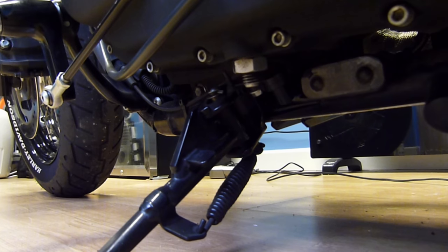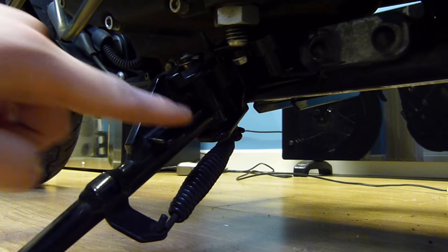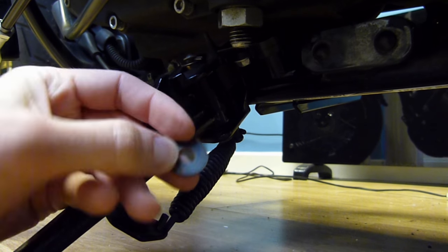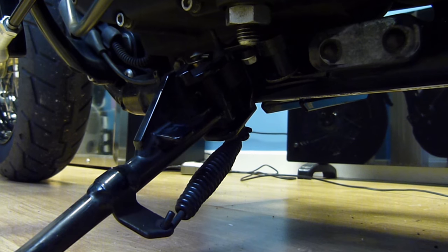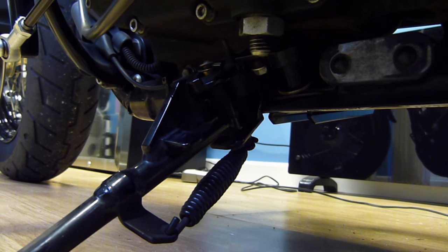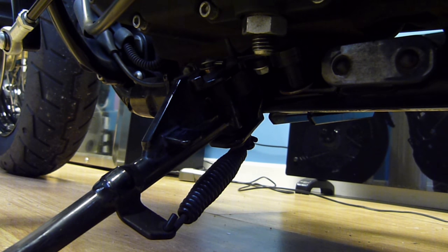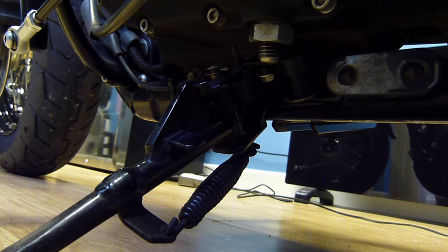Back in the garage and under the bike — you can see here the issue. Here is the plate I was talking about, and this piece here is the sensor that needs to detect it. The solution is really quite simple. All I have here is a small metal washer — you can use a coin or a rare earth magnet, whatever you fancy — and simply putting it on here, it attaches through the magnetism of the switch and will permanently override the sensor. I've ridden with this attached for about 2,000 miles through all kinds of weather and it hasn't come off. No adhesive needed.